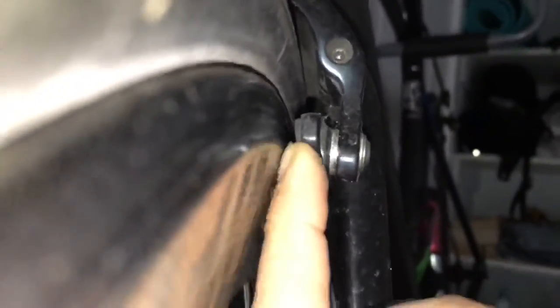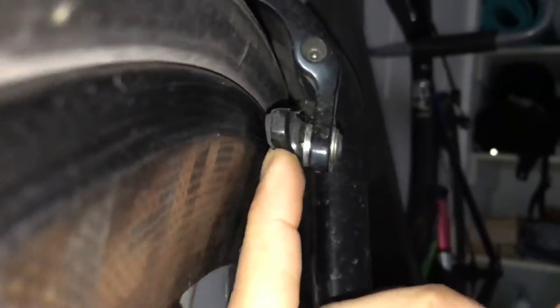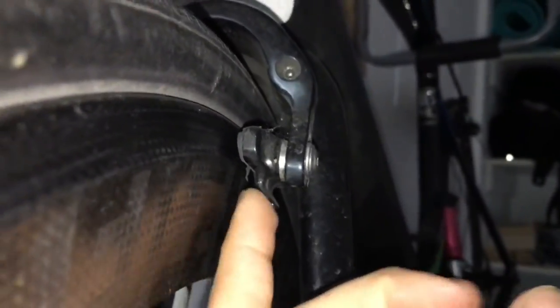And here's a tip: remove those little things, because as your pads get worn, they can scratch your rim, destroy your rim. So those pads, I should replace them pretty soon. I keep an eye on my stuff a lot. So always keep an eye on your stuff if you're using carbon rims or any rim. Just pay attention to what you use. Safety first. Meilenstein Gen 4 clinches.